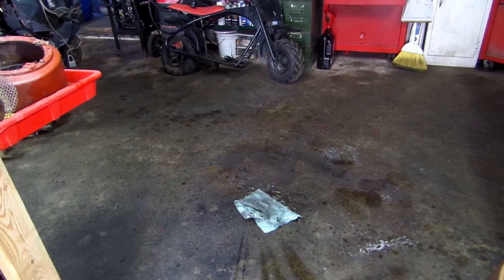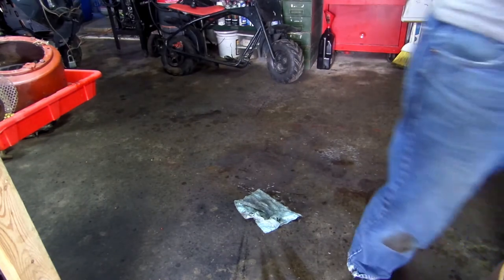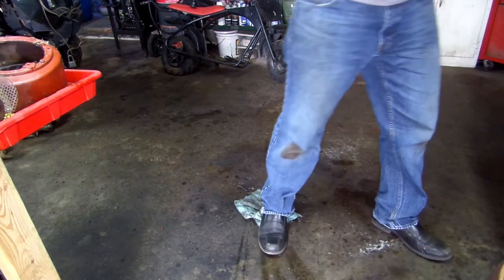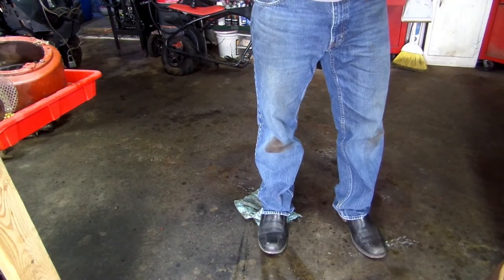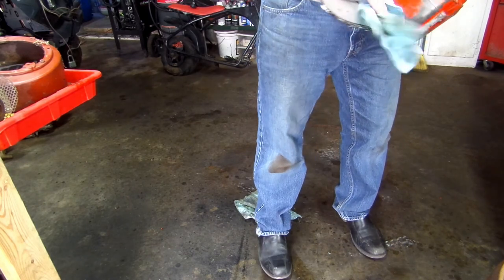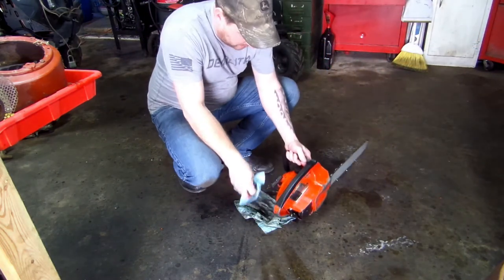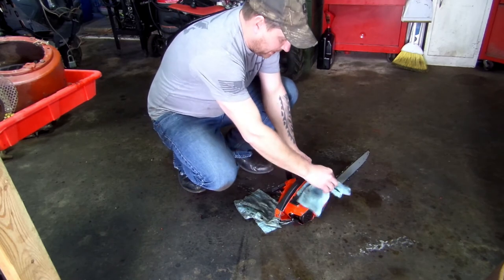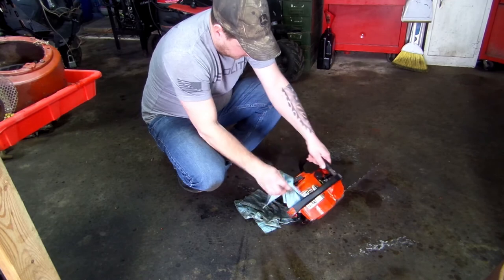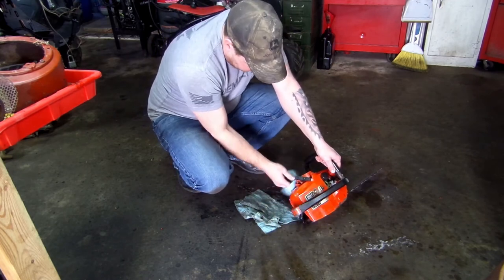Alright guys, I did have to take the carburetor back off and adjust that metering diaphragm. It was flooding the system out, but I got it all put back together. I still have to order, and I'm going to put it in the description when I edit this video, but on top of the gas tank, there's another hole, and there's a duckbill valve that goes in that hole that keeps gas from leaking out, but lets air come in. I'll put that part number on there, and you insert it. If I remember correctly, you just insert it in that hole from the outside. But, alright.